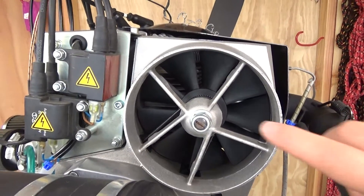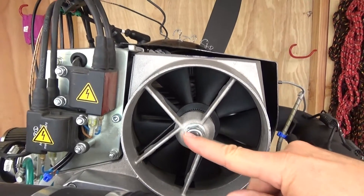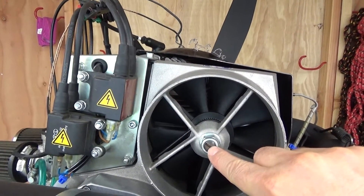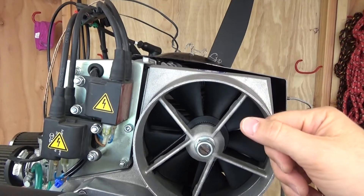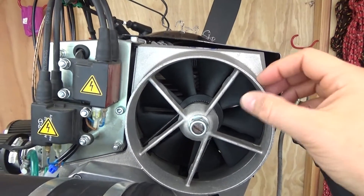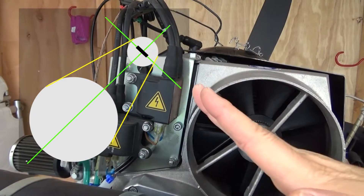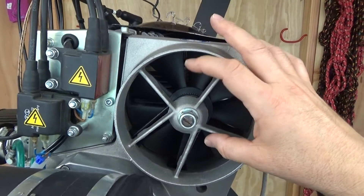One of the main things to consider is belt tension. When I put this belt on, this bolt was in this exact position. It's on an eccentric cam type deal, so as you turn this bolt — not the nut, but the bolt — it actually tightens or loosens depending on how you turn it. In order to get it to its loosest position, which is what you want when you first put a belt on, this notch has to be at a perfect 90-degree angle to the belt — not horizontal, but just like this. That way we know the belt is under the least amount of tension.